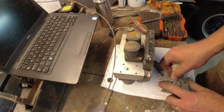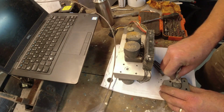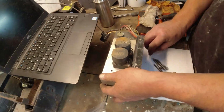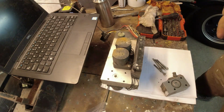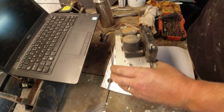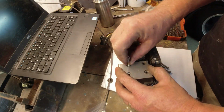Now, I don't know if we're supposed to lubricate these O-rings or not with a smear of Vaseline. I don't see that it's going to do any harm, so I'm probably inclined to do that. Let's check out where that spring is, which is over here somewhere. There it is. Making a bid for freedom. Oh, petroleum jelly. And then all I'm going to do is just smear that over the seal. Pop that back over the top of the spring and down. Put these bolts back in.